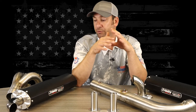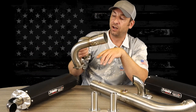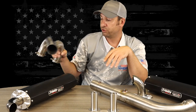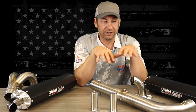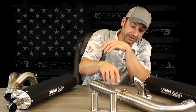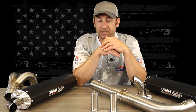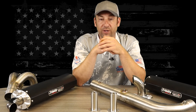These are designed to give you a deeper growl and let the motor breathe — all the pieces that help increase performance but don't make it obnoxiously loud. You get a nice deep growl and it performs well. These are all TIG welded — you can see the beautiful TIG welds — and it's all 304 stainless, which is the higher-end corrosion-resistant grade. Traditionally there are two types of stainless used in exhausts, and the 304 is the higher-end protection. All the pieces come with it: the billet assembly pieces, the nameplate, everything you need to swap out your exhaust. Free shipping, 5% cash back in the rewards program — check that out. If you have any questions, let us know. Thanks.